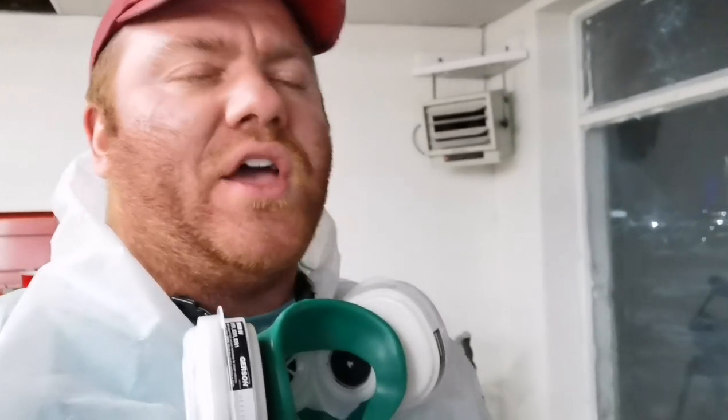Another shrink test I did on something a little smaller, and I want you guys to notice this. This is another 2 week shrink test. Look at this, ready? All of our clears have flex additives in them. Not only are these clear coats salt tested and UV tested for thousands and thousands of hours, but they also flex really well even after a full cure. Like I said, this one's been sitting for about 2 weeks in a cup, open, lid completely off, and it is still very, very flexible. What does that mean? Better adhesion, better durability, overall better quality job.